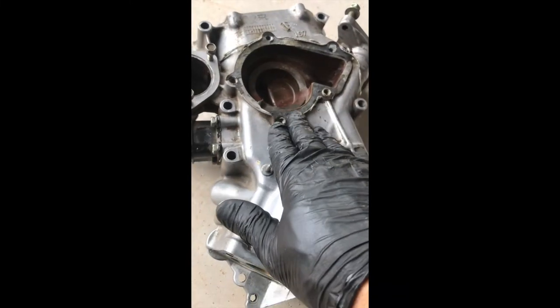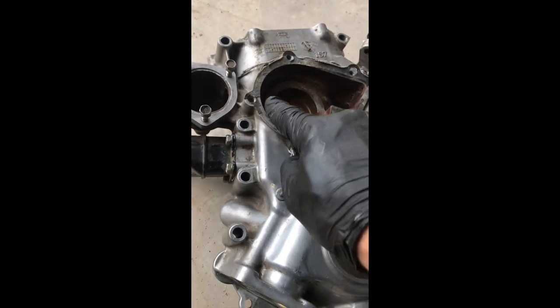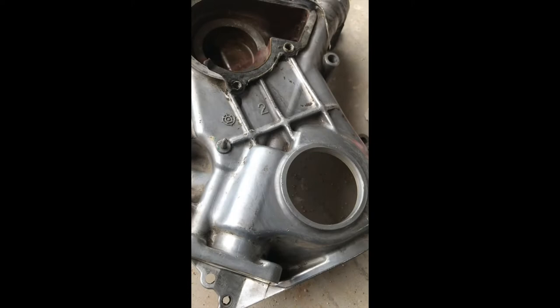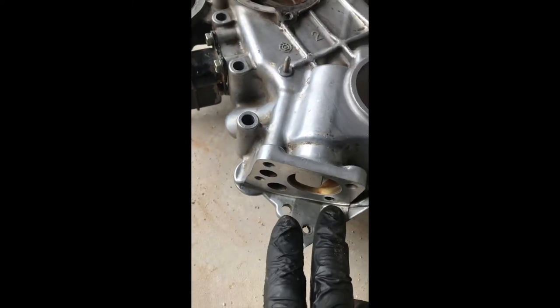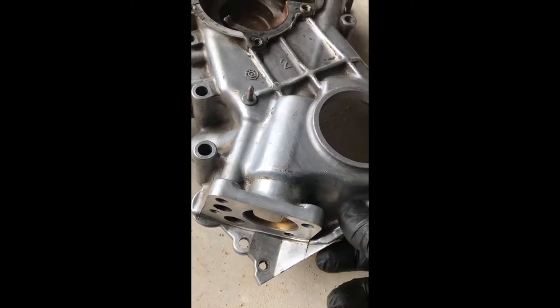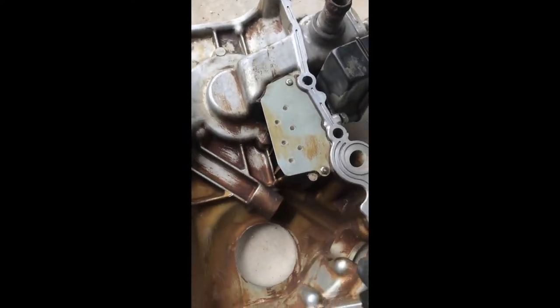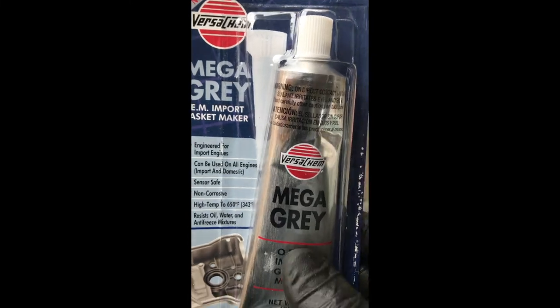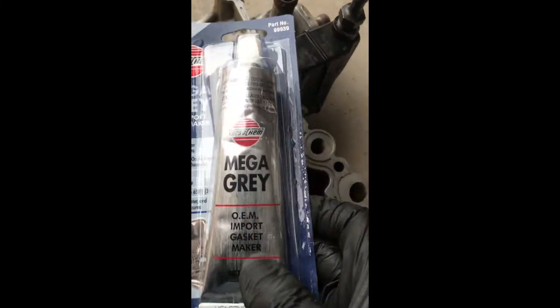Next I'm going to change these two washers — they go here. New ones come in the kit. Then I'll work on the chain cover and install the water pump. The torque for the water pump bolts is 6 to 8 foot-pound. I put a new seal here. The thermostat will go here, and the oil pump will go here, but I can't put the oil pump on now because I need access to bolt the cover to the engine. There are no gaskets for the chain cover — you need to buy a gasket maker, which came highly recommended by O'Reilly's.